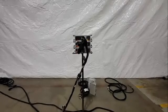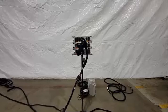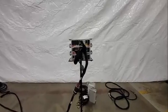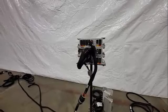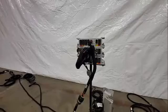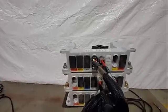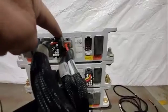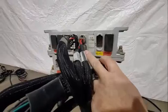We will now go through the connections at the ECUs on the first implement harness. I've removed all the corresponding harnesses except for the actual ECU connections. In this scenario, we've got an EM24 doing blockage, an EM24 doing our liquid NH3 sectional, and a CM40 which is going to do pack master. Each ECU is going to be plugged into the comms here, and they're all going to have an ECU power — the 2-pin plug — and power — the 4-pin plug.